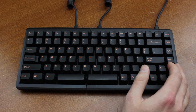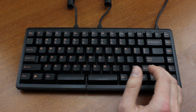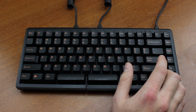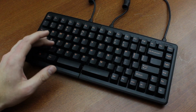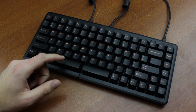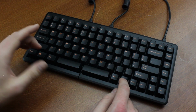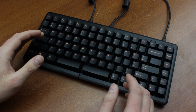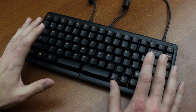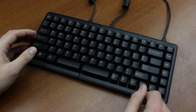Now, you might be wondering, does this mean that you can also program macros truly on the fly and without having to use external software? And yes, it does. The macro programming and key remapping function does have some awkwardness and limitations, but it's overall pretty good. The first limitation is that macro programming and remapping can only be done in one of the three function layers, not the default layer. However, the FN layers aren't accessed per key using FN plus that key, they're switched to and then left there so you can work in an FN layer all the time with no difficulty. And the second limitation is, it's ridiculously complicated. And you can't program or remap any keys that are not on the keyboard, but the second one warrants a bit more attention.